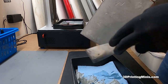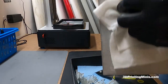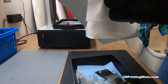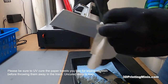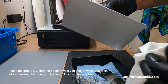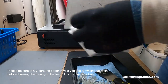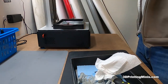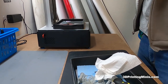Any little pieces that come off, put them in here. Get a paper towel — just any regular paper towel. Flat on the flat part, wipe this down, get any pieces off. Wipe the edges. Check the back to make sure there's no pieces or nubs floating on it. Honestly, because this plate is just going back into the resin to print, it's clean enough and good enough to print with. Put this back on and always be sure to fasten your build plate on in case you forget later.